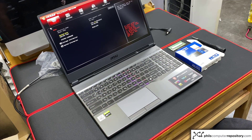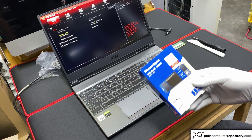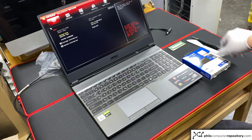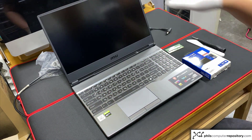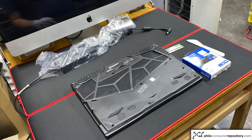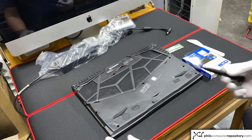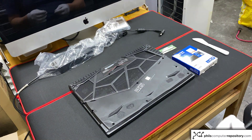Hello! In today's video, we have the MSI GP65 Leopard laptop series. In this video, I am going to be opening this up to show you upgrade options. For this particular customer, we will be upgrading the 512GB SSD to a 1TB SSD, and we will be adding a second 8GB RAM for a total of 16GB of RAM. The tools I'm going to need for today's disassembly and upgrade video is just a simple small Phillips head screwdriver, a plastic wedge, and the components that we are going to upgrade with.